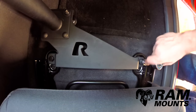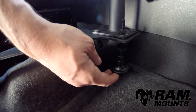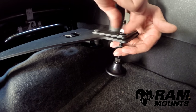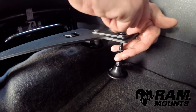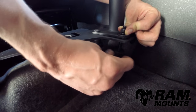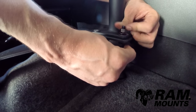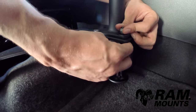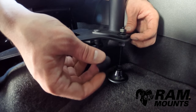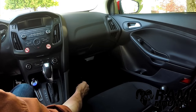Double-check that all bolts are fully secured and the mount is stable. The foot stabilizer at the end of the base flange is still loose — spin the top nut to loosen it and lower the stabilizer down until it contacts the floor. Then take the middle nut on the stabilizer and loosen it upward so it braces against the base, keeping the foot stabilizer completely steady. This will vary from vehicle to vehicle. You can also use the spare rubber cap from the lower telescoping pole over the top.